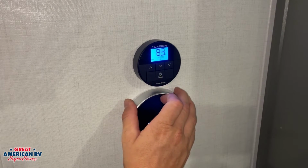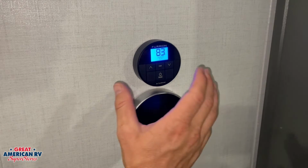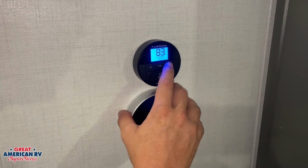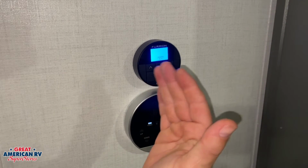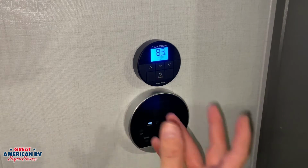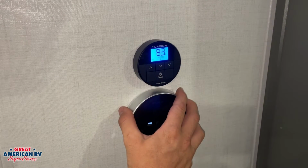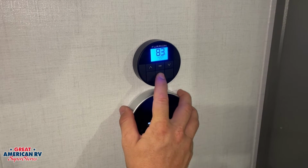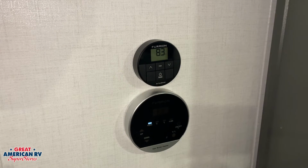Our next mode is our dry mode. Our dry mode works as a dehumidifier without freezing you out of the unit. It will cool the unit down to the set point that you have it, so in this case 71 degrees, and it will alternate running and shutting off to try to help keep the air dry inside your unit without reducing that temperature down any further. When we're ready to shut that system off, we hold that mode power button on and that system will shut off.